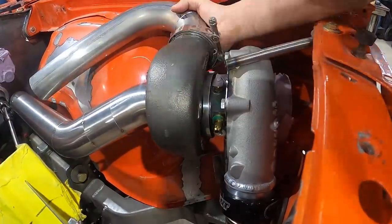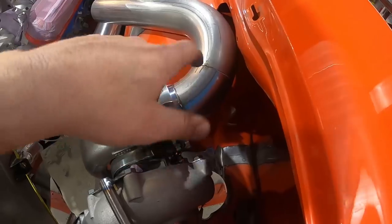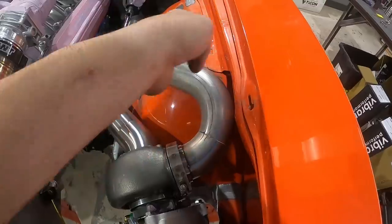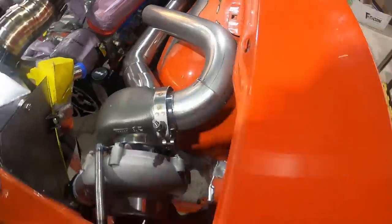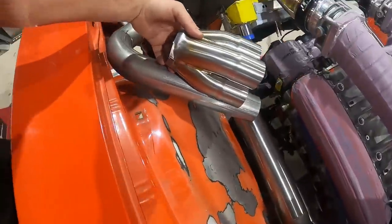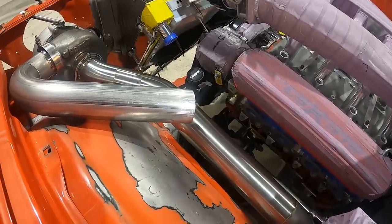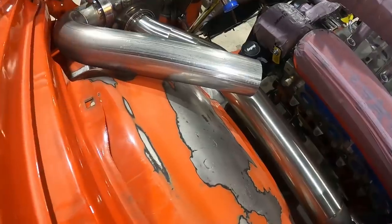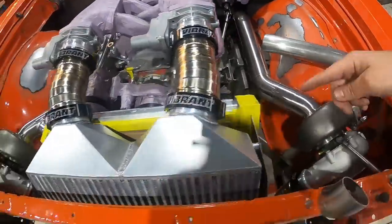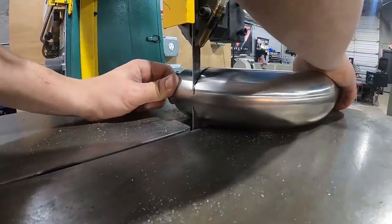What I had to do was add another 90 — I cut a quarter of a 90 bend. The reason I use this instead of a complete U-bend is because this one's clocked a little bit, so it's kind of coming up and then jogging over the inner wheel well. From here we're going to take our shrunk-up collector and position it there. I want to do the passenger side like this first to make sure I get these J's looking even on both sides so that one side doesn't look too different from the other.